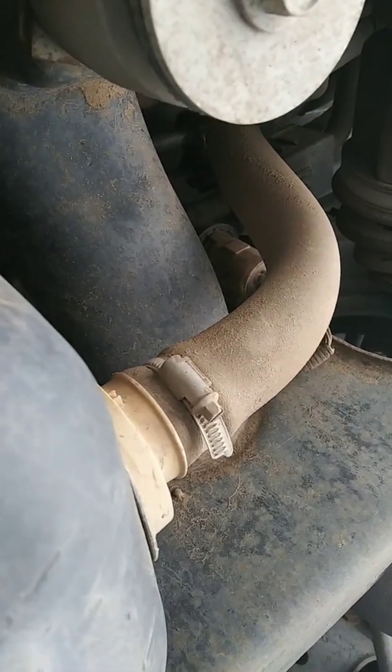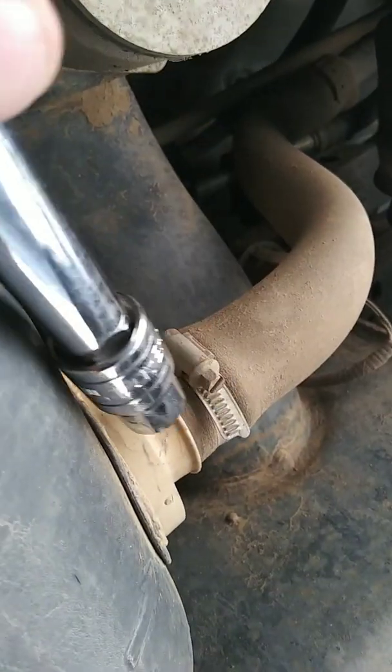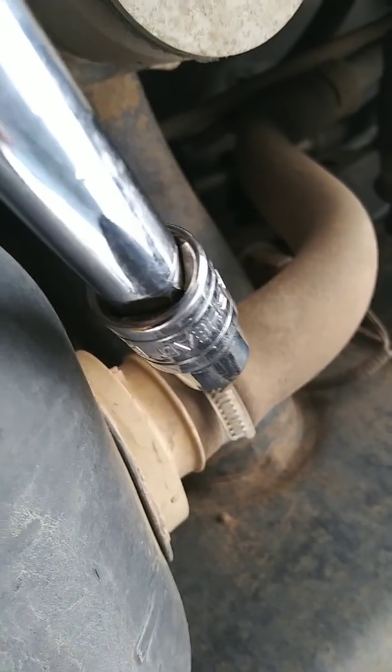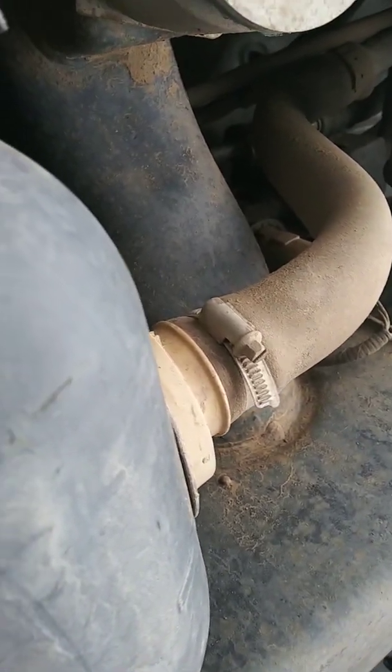And then there's the hose for the fuel filler neck, which has a little internal baffle in there. So when you take that out, there might only be a tiny bit of fuel because there's an internal baffle. But I still stick a paper towel or a rag in there anyway, just to keep debris from getting in that little spot. But once you get those down, then you're going to have to contend with the wires and such on top of the tank, and all the fuel lines.